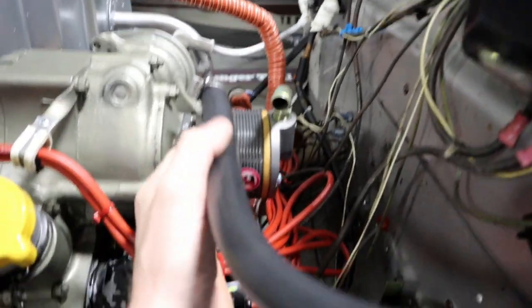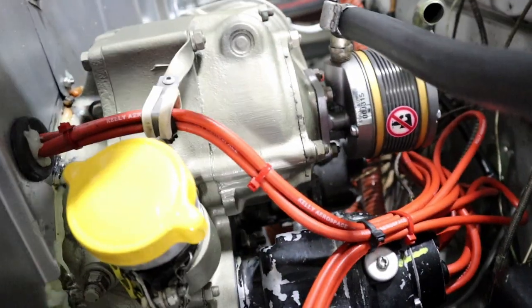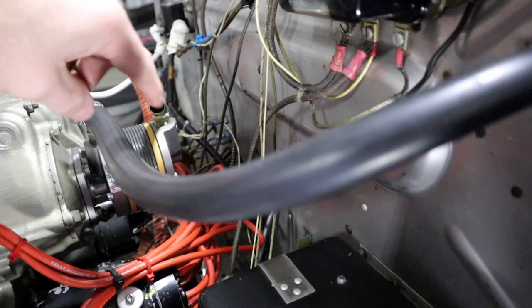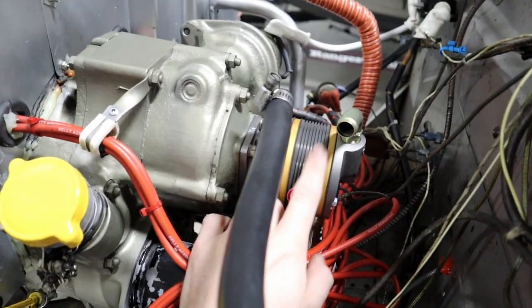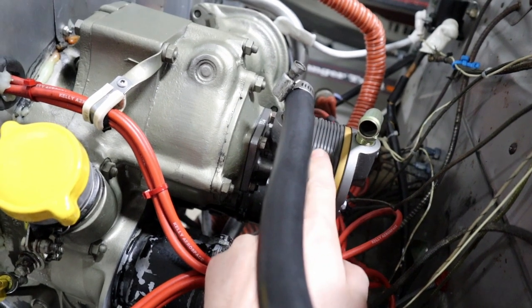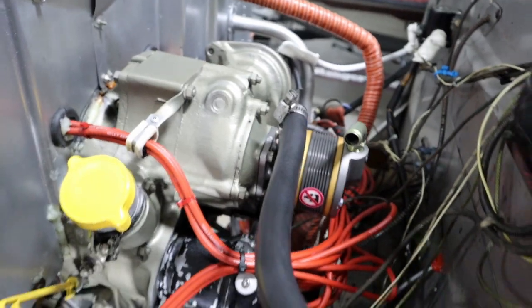This right here is a vacuum pump. When the engine's turning there's a bunch of gears in the back, and those gears are turning accessories — it's turning your magnetos, it's turning your generator down at the bottom. This vacuum pump works just like a vacuum cleaner: it's sucking air through this line through your instruments and blowing it out this little hole. You check your suction gauge to make sure it's working correctly. If this seizes up, there's a little shear pin — it'll shear that pin and you'll lose suction. If you lose suction your attitude indicator and directional gyro are not going to work.